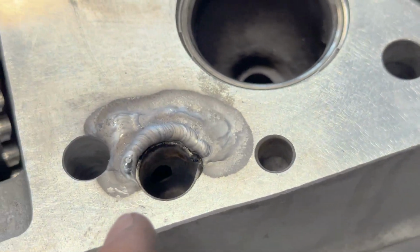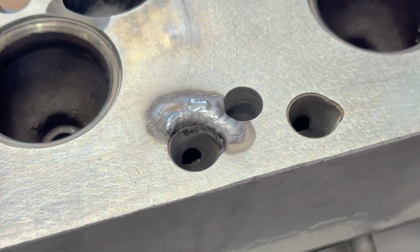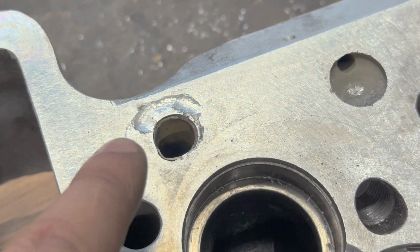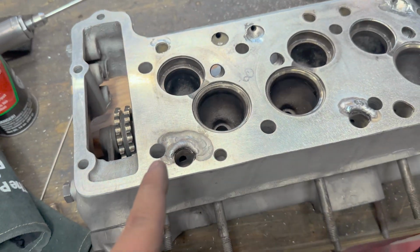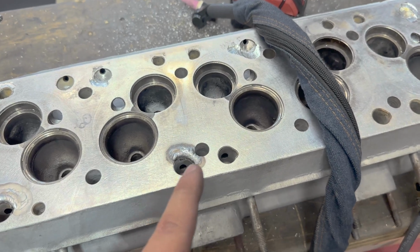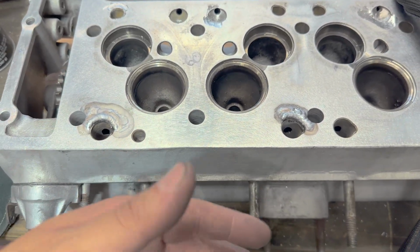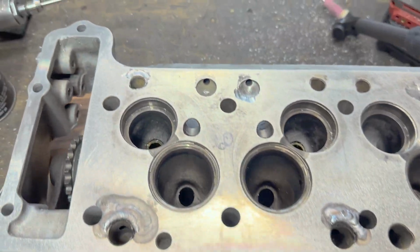I did melt the edge of that cup a couple times, and it looked a lot like stainless. So I'm a lot less worried about welding around these areas. I'll try to get an arc shot of this. It's really nasty. By far, this post-war era aluminum is very, very gross. And it doesn't help that I'm already welding something that's a very far derivative of aluminum because it's already been rotted by calcified, gross water. So we'll get there.